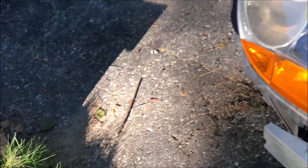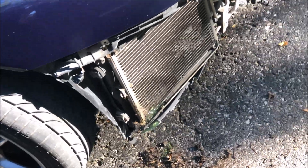There's two condensers on this—one on each side behind the bumper. You don't need to move the motor to get to it. This one here doesn't seem to be leaking; I don't see anything coming out of that. But this one—yeah, 100% for sure. I'm going to be replacing this condenser and I will show you that when I replace it.